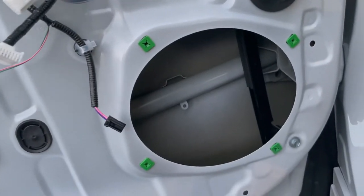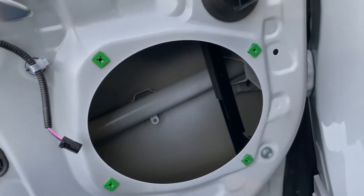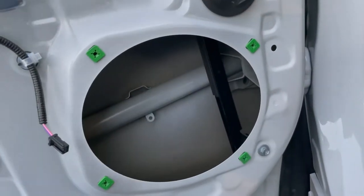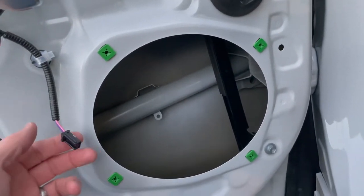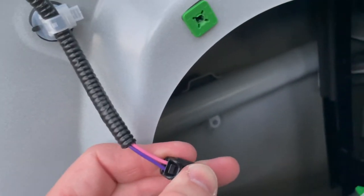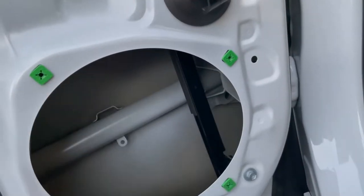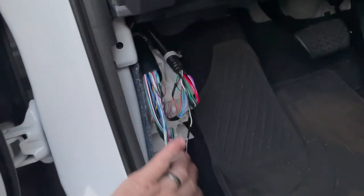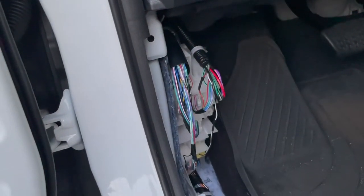This is Aaron and I'm going to talk about the door on the Sienna and the door speakers. I've gone ahead and removed the door panel. You can see this is the factory speaker connector — it has the purple and pink wiring. This is the factory hole, and this wiring traces up through the door and terminates down into this block on the driver's side kick panel.